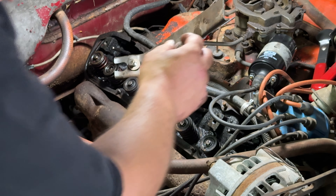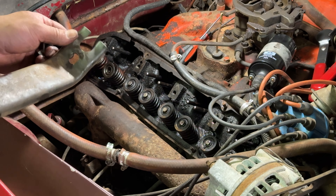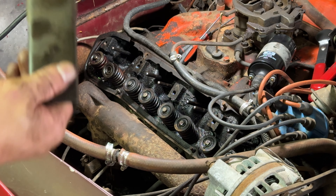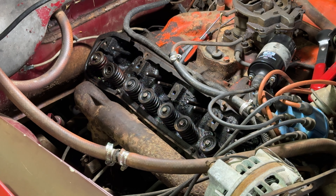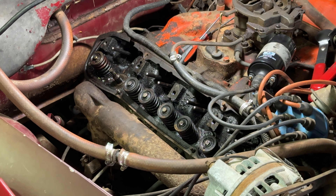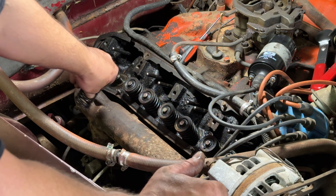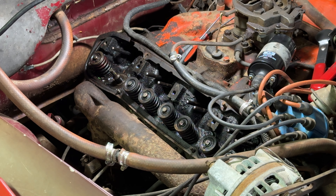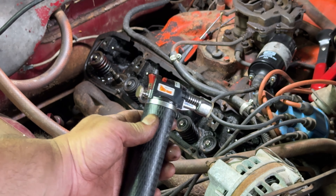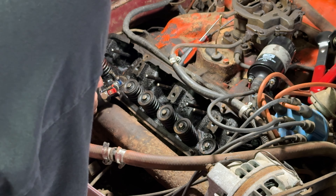After some ingenuity, I had to end up using this Chevy valve spring compressor, the old number 912. We'll use that on a big block or small block Chevrolet sometime. Anyway, we got this off — spring, retainer, the one clip. I screwed up: I pushed the valve down while I didn't have the spring on and tapped it down too far. That was my bad. Now comes the fun part — the unsticking of the valve. We're going to try hitting this valve with a little butane crack torch first. She's pretty stuck in there.